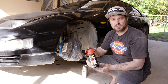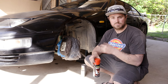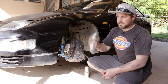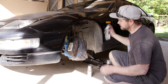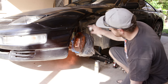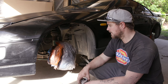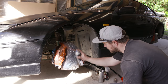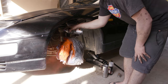The first thing we're going to do is apply the colour in a couple of coats. The first coat being fairly light — we're going to dust that on there to make sure the paint sticks. The second coat will be heavier, and then heavier again, and after that we'll add some clear. Give the can a good shake and dust it on there. A couple of mouthfuls of beer and five minutes later, we're probably ready for another coat. The second base coat is going to be a little bit heavier — full coverage.